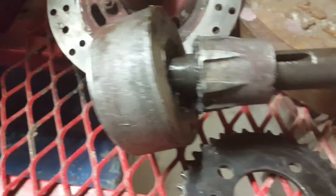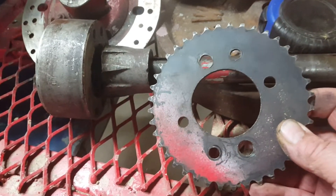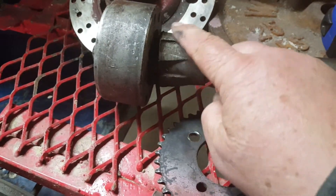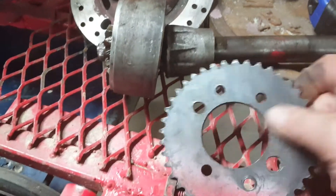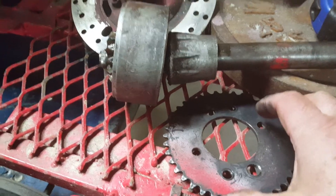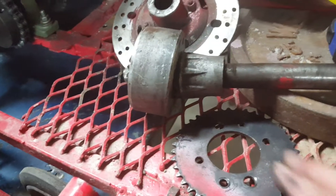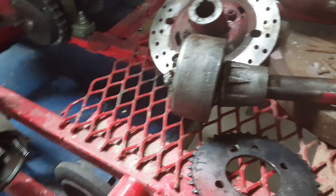One reason it may have failed: when I put this axle together, I ground down a lot of the webbing on the aluminum housing because this sprocket is exactly two inches, and to get it to fit I had to grind that down. I've heard of others doing that on other track vehicles. What I probably should have done is grind the bore out farther and leave that webbing alone. With a six-and-a-half horse and the correct sprocket, you wouldn't need to grind the webbing, so it'd be a lot stronger.